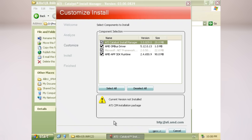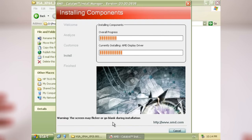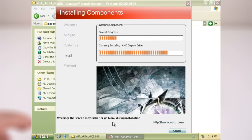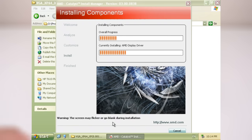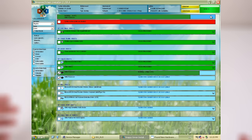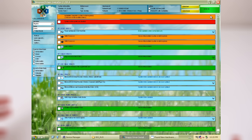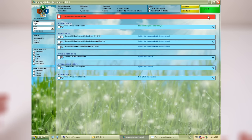Once we have Windows XP installed, it's time to install some drivers. Officially this machine is not supported by Windows XP, but I just went to the ASRock website — they've got an A55 Pro 5 motherboard with the same components and there you can just download the chipset and graphics drivers. To install the rest of the drivers, I just used the Snappy Drivers project. It found the drivers for Ethernet, sound, SMBus, and also the HDMI audio and other components.